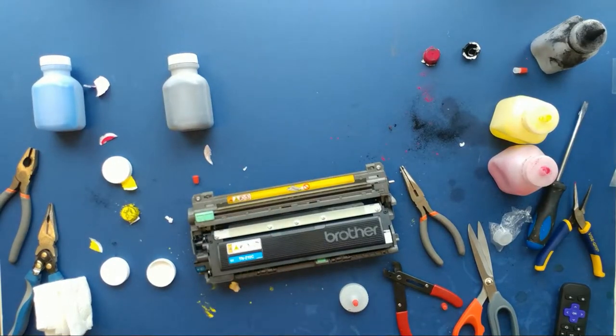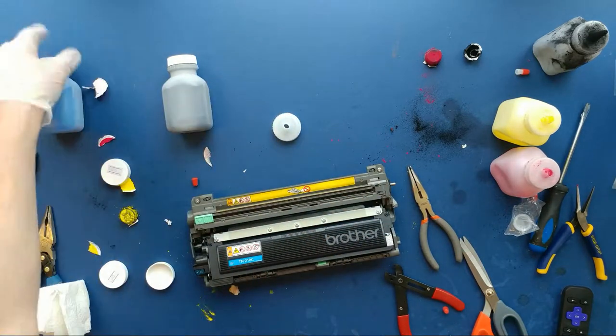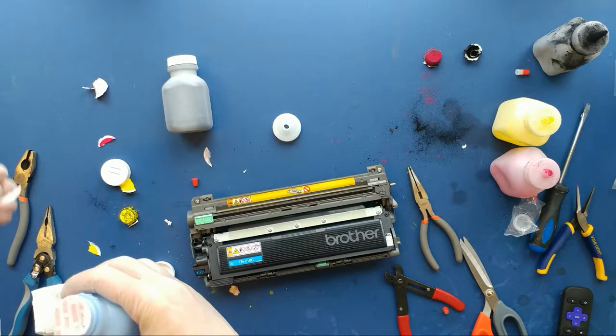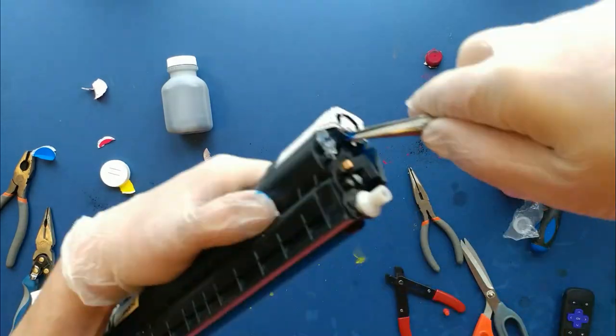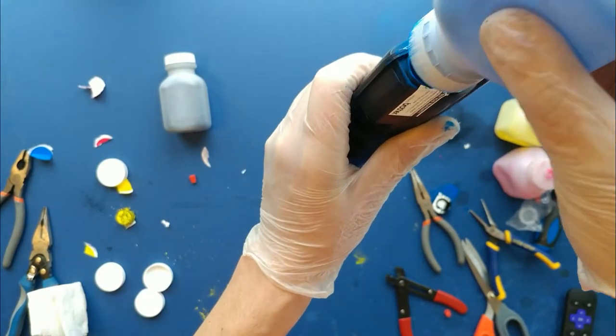After the third cartridge we got really into our groove — we got almost everything sorted out. We were able to get the little seal out better. We still ran into some problems with the toner itself, and we figured that out on the cyan (the blue), which was the final cartridge where we kind of hit a home run. Here we have the cyan blue — I'm going to cut my little piece off first this time so I don't have to hold the toner cartridge up while I do this. JL Toner is where I got this — not sponsored in any way. By the time we got to the fourth cartridge, the blue one, we had our system down pat. It came out quick, the toner went right in, and we set up the toner ahead of time — it worked out quite nicely.